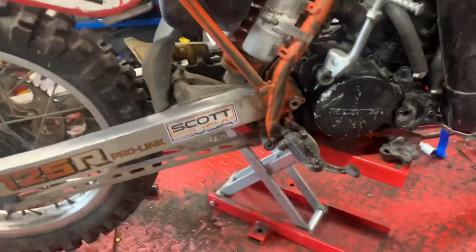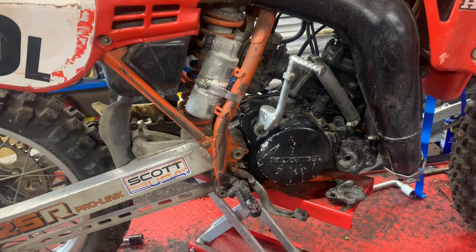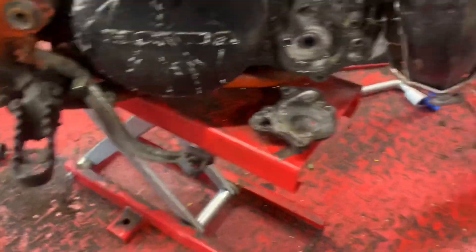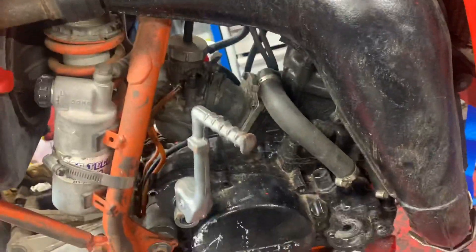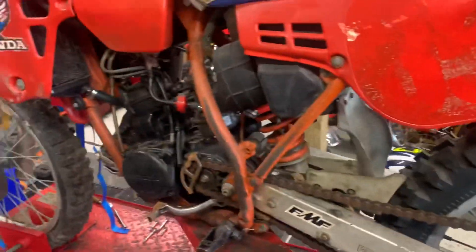Overall it's relatively complete — it's not missing all of its major components. The rear rim is straight on both sides, the rear brake plate is there, but the front disc is missing the caliper. So it's going to need: a front brake master cylinder and caliper, front fork tubes, work on the water pump, bolts for the clutch cover — which should be salvageable — and an inlet manifold. I think that was it for the missing bits.